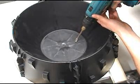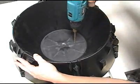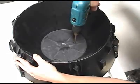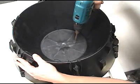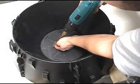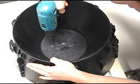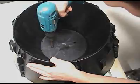Using the wheel stud measurement you took earlier, drill 2 holes using a 1/2-inch spade bit on either side of the center line. In this case, we are drilling a 110 millimeter pattern. So we are drilling 55 millimeters on one side and 55 millimeters on the other side. This particular pattern is pre-marked on the scale and indicated with a number 110.